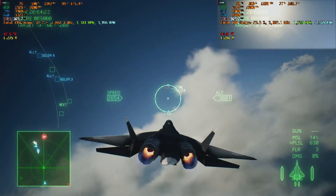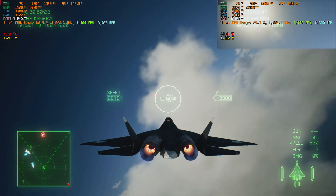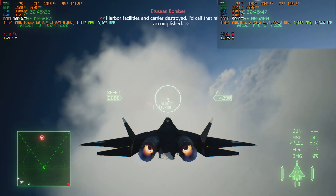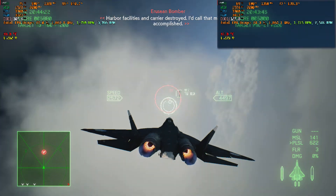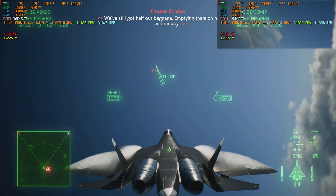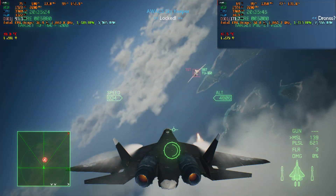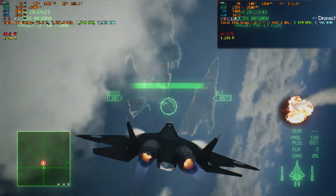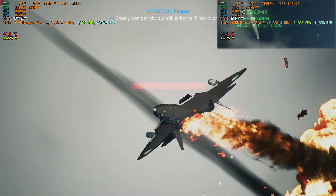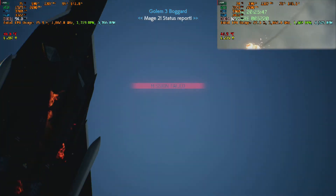We can see that the GPU is definitely cooler now — by about 2 to 5 degrees Celsius after replacing the thermal paste. The GPU fan is also much slower now by about 500 RPM, so it's also quieter. We can say that the thermal paste replacement was a success. That is all for me today guys, thank you for watching. Remember to like and subscribe. Bye!